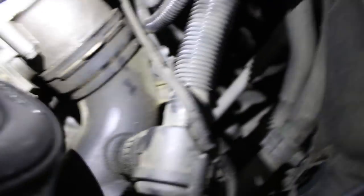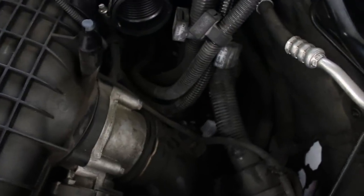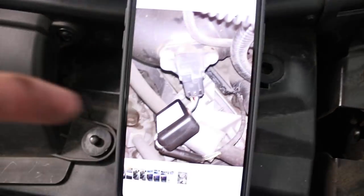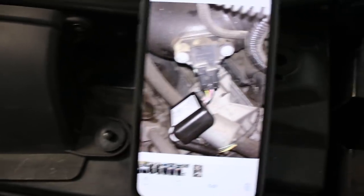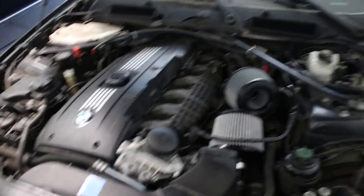After removing the intake, you can see the sensor right there — the sensor is upside down so you can see the cable sticking out of it. You just disconnect the sensor and literally plug the JB Plus in between the sensor and you're good to go. It's that easy. The sensors pulled out now, and I'm going to put the JB Plus tune in between. That's all there is to it. At this point it's in there — you can see the CARB sticker, that little white piece of paper. That's the JB Plus tune. You just plug it into the sensor and then plug it into the car — it's like a little adapter in between. I'm going to reinstall the intake, close the engine bay, and start up the car. Just like that, it's installed. Filters are there, intakes are there, and the tune is down there. Let's start up the car and take it out for a little drive.